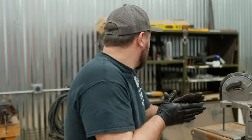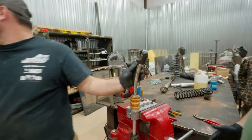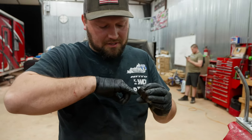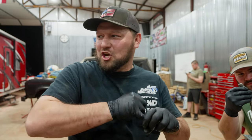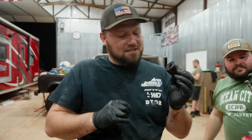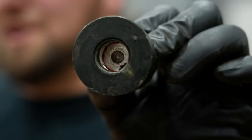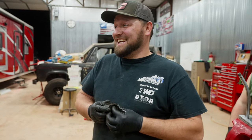So this is most likely thread-locked in, so we need to put some heat on it. In my experience — my limited knowledge of this stuff — blue Loctite on aluminum is fine, but red Loctite on aluminum may not be the best bet because you may never get it off, or may never get it off in a usable fashion. It's just more parts that you have to buy.